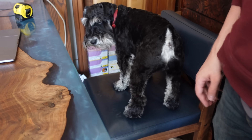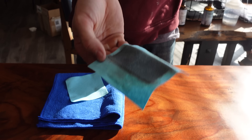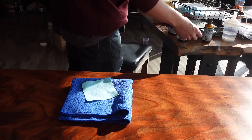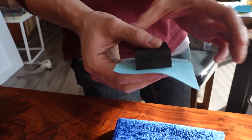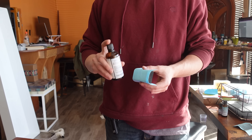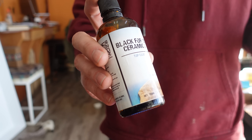It's been about half an hour, and I want you guys to take a look at the pad we used for the graphene. You can obviously see there was graphene in there — lots of solid content — and it'll actually turn your pads black. So I'm not going to use this one again for the top coat. I'll set that aside and use a fresh pad. Now that I'm on to the ceramic top coat, I can do even larger areas than I was doing before — this has a longer open time than the graphene. So it's a lot more forgiving and you can do larger areas.